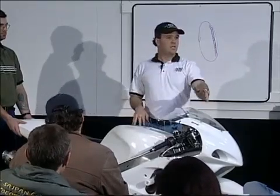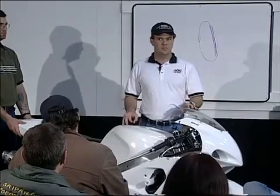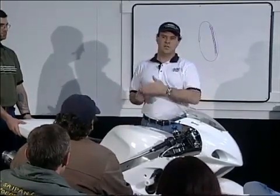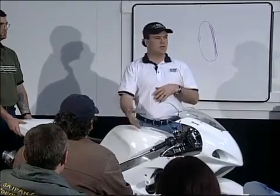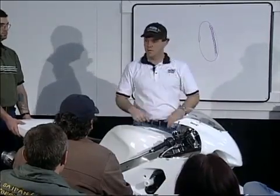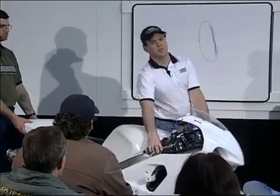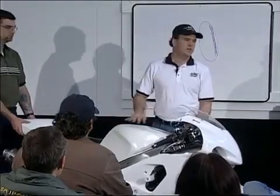They're dangerous cresting hills. Anytime you're cresting, anybody ride at VIR ever? Mid-Ohio. Any place where you're cresting hills, and it's even worse when leaned over. If your bike doesn't have that free sag for that wheel to be able to reach out and find the ground, that's when they skate. They're wheels looking for the ground. All right? So wobbles and all kinds of things result. So quick check for free sag. I know it's there. You know it's there because you've just worked at setting your sag.